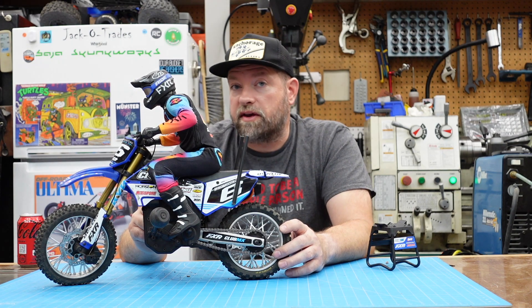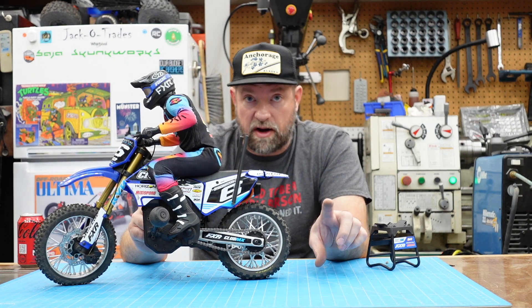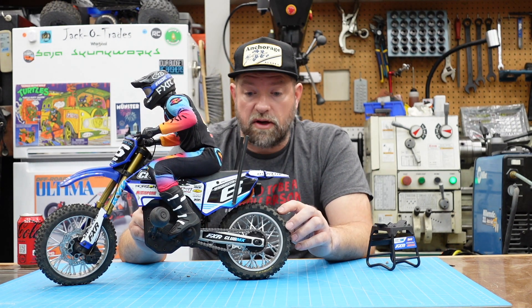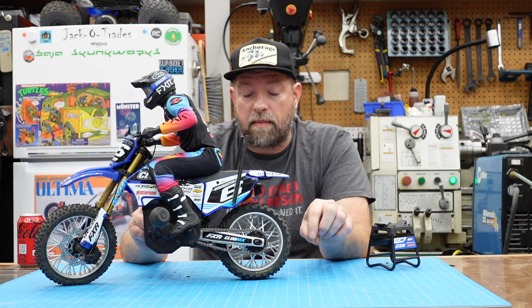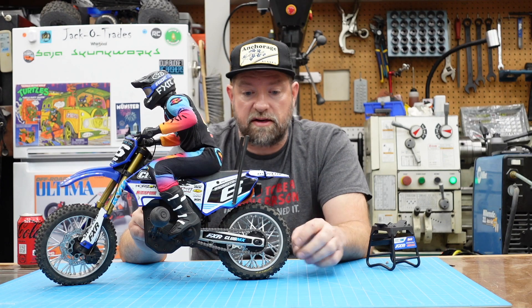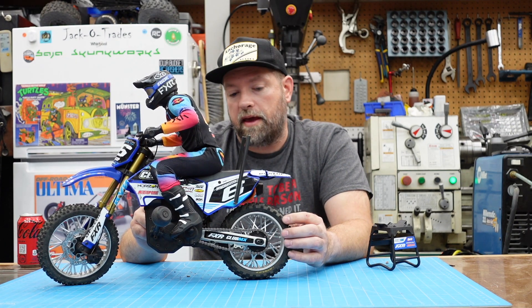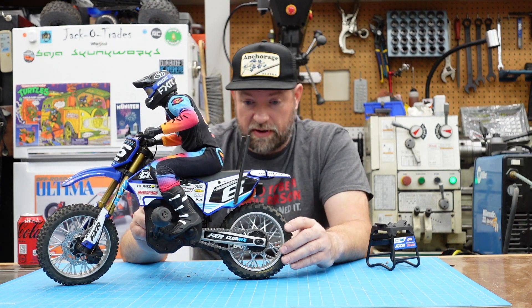I think I'm a little over-geared now because I didn't hit my 58.5 miles an hour target. There's going to be an optimization where I'm basically hitting the speeds I expect from my calculator. If I go with a slightly larger sprocket — like a 26 or 28 tooth instead of the 24 — I think I might be able to hit 54 or 55 miles an hour.